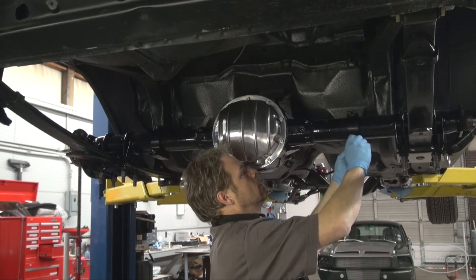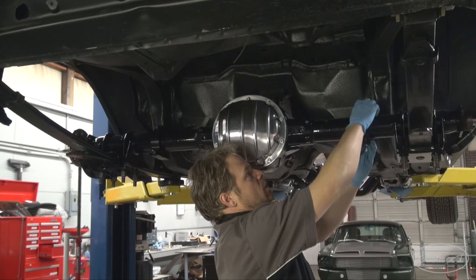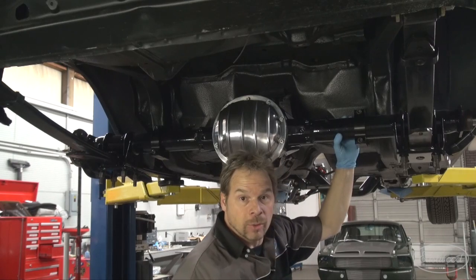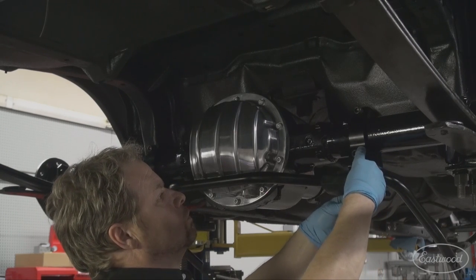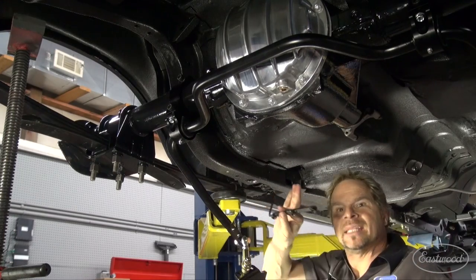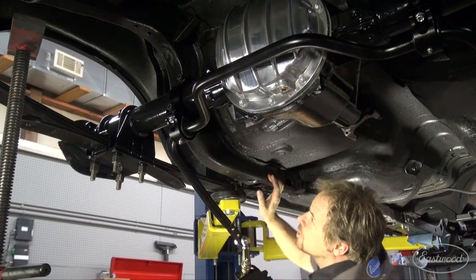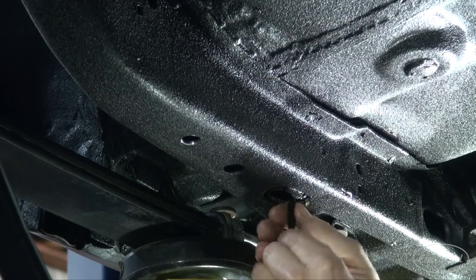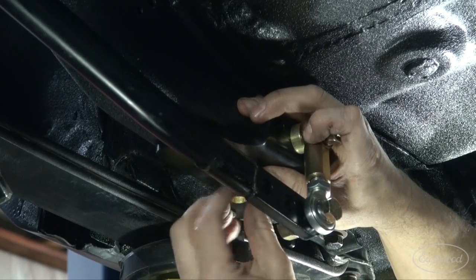The Classic Performance Products anti-roll bar is a really trick piece, using anodized clamps on the axle tubes. There's more to this than just rebuilding the axle assembly — there's a lot of external stuff too: a sway bar and some beautiful shocks. The new sway bar is a larger diameter than stock and uses different geometry to control body roll. Using the bracket provided in the kit, we mark for a mounting hole on the other side of the frame rail and drill. The end links allow for preload adjustment with the sway bar, something the stock system never allowed — so now we can actually tune the setup on this car.